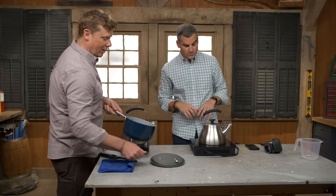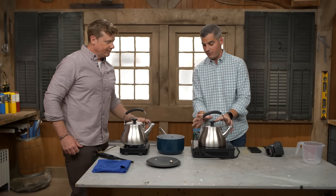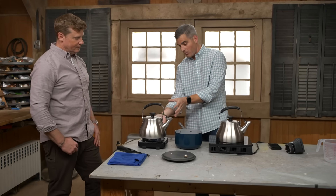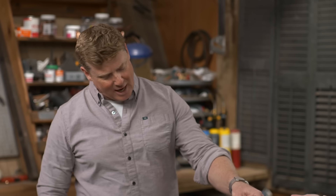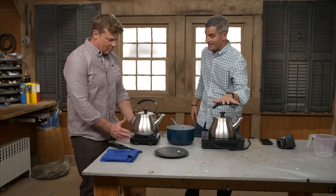It will work. And no good there — doesn't work there. So this is a targeted process. The induction cooktop is targeted for this pot and pan, where gas is not targeted so much. Some of it goes to the pot, but the entire flame's underneath — the rest of it's going to the surrounding air. So this is 80 to 90% efficient, while gas is 30 to 40% efficient.